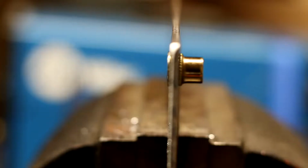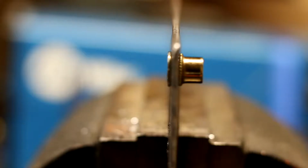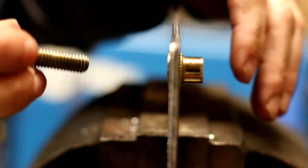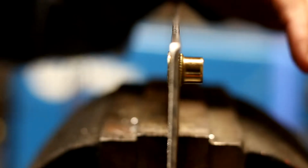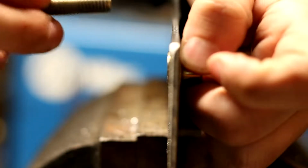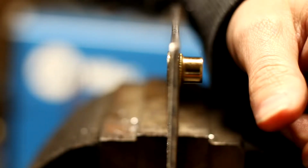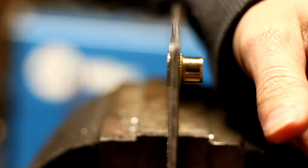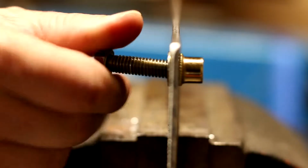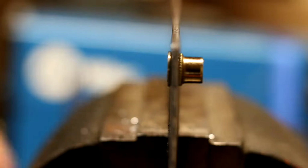We used just standard nuts and bolts, and what we found was it took way too many hands in there. We actually had 3 people trying to hold everything back, and one guy trying to hold a wrench back here, and one guy trying to tighten this, and it was just way too many dudes in the back seat of a truck, for sure. So after that negative experience, we went to riv nuts, and it's so much easier and so much simpler.